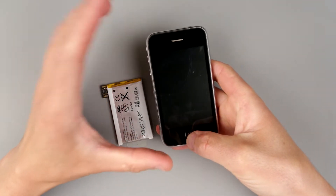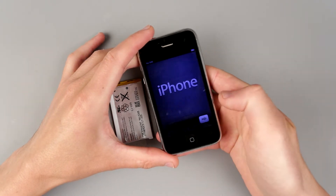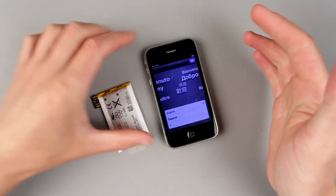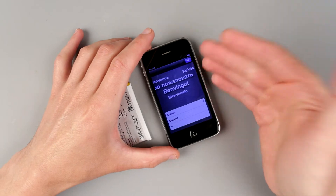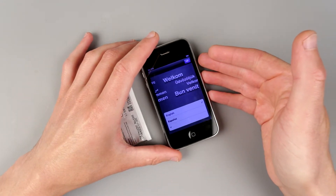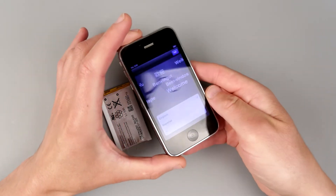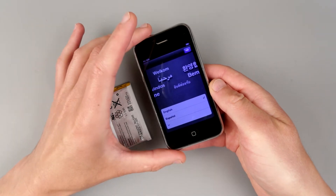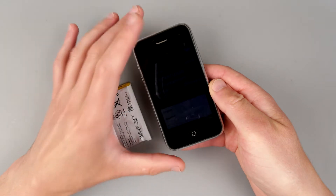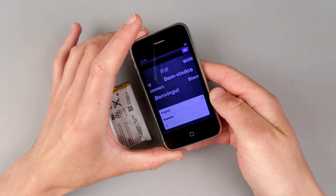I think we have a success. After replacing the battery, putting the phone all together, and leaving it on a desk charging overnight, the phone is actually quite a bit operational, and it's kind of surprising. Originally the battery was measuring 1.6, 1.7, 1.8 volts — pretty much gone. I even contacted the original battery supplier saying what the hell is this battery. But after a while the phone was actually able to pull charge into the battery, and when I looked again the battery was measuring 3.7 volts. Now it's completely charged and seems to be completely working. Also, this phone was actually bricked — so in addition to changing the battery, I also restored the firmware. Now this phone is brand new with the latest firmware available for this 3GS.